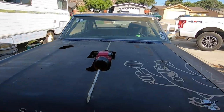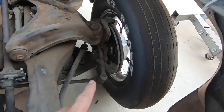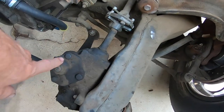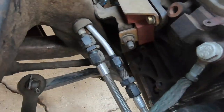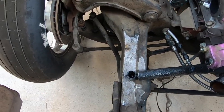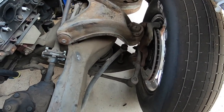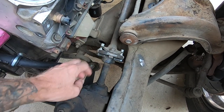What we've got is our stock 1964 suspension up front - stock suspension, and I upgraded it with some Chinese aftermarket discs I haven't even adjusted. It's a stock box, drag link setup. Down there it hits the oil pan on both sides, lock to lock - it's chewing up the oil pan. Holley makes a pan where it doesn't do that, but I don't have that pan. The rack and pinion should cure that supposedly - it's bolt-on is what I was told. We'll take the sway bar off too since apparently you don't need that when you drag race.